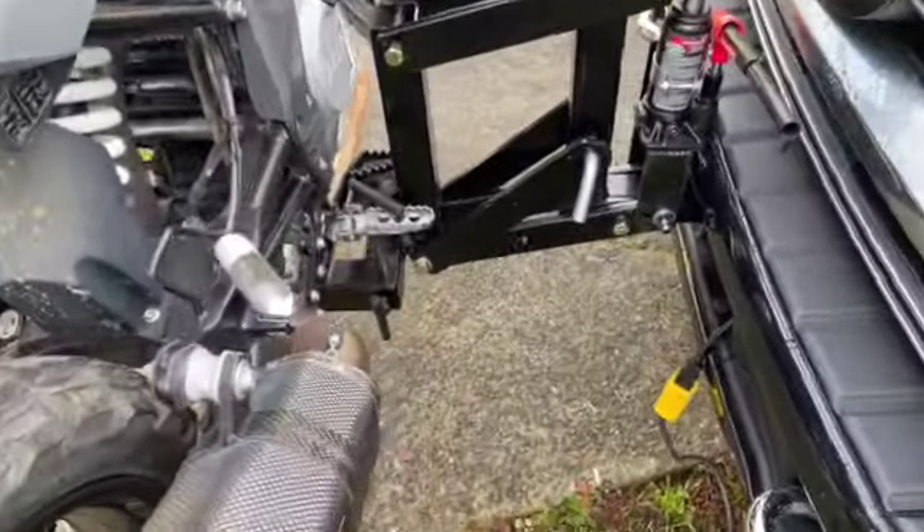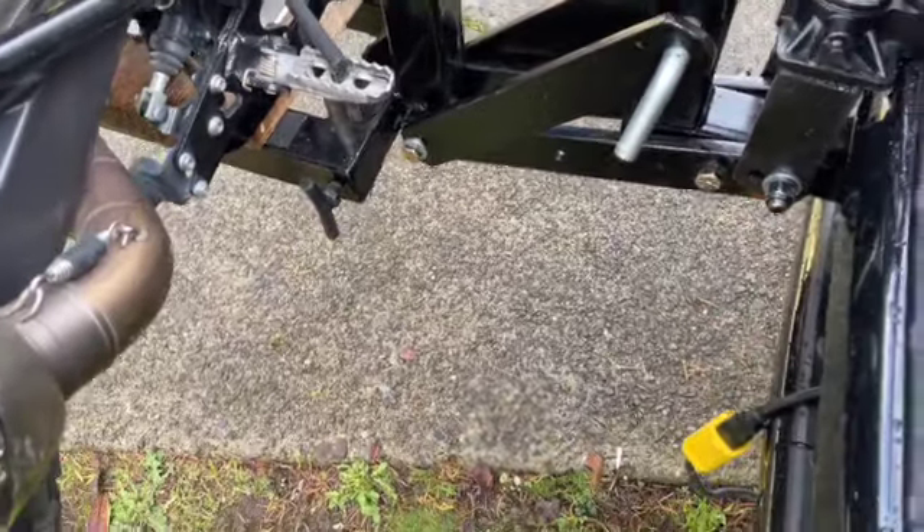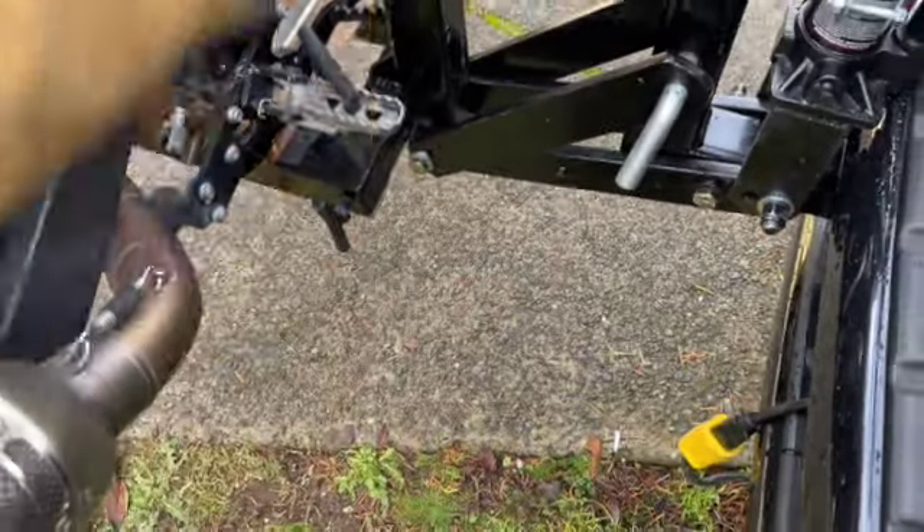Over the changes again: I shortened it two and a half inches here to reduce the leverage from being further out. I added this brace here to lock it into place with the pin — that locks it from bouncing. When I want to get the bike off, I pull the pin and lower it down. Getting it off is easy — it's just getting it on, because it doesn't go down quite low enough. It needs to go down another five inches. The way I can make that happen is to get a drop hitch, which I still may look into when I get to the States — put the drop hitch on, get it down a few more inches.